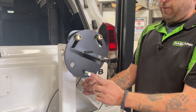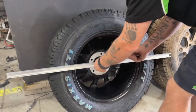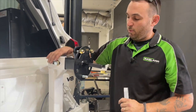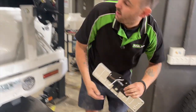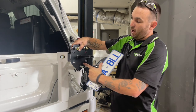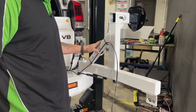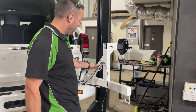The next thing is the wheel plate. This dimension from the mounting face to the upright needs to be 10mm less than the backspace of the wheel. Measure across the back of your wheel and into there — if it's 185, we want this distance to be 10mm less, so 175. Do that up super tight and it needs to touch the upright — that's why we have the crush, it's like a big spring washer. The number plate bracket is a two-piece that goes behind the wheel: nuts off, bracket on, wheel on, and it will poke through the hole of your wheel, then the bracket bolts on once the wheel's on — so that's behind the wheel, not in front. The bracket on here looks like it's backwards but when it's open it will read the correct way. This bracket is for if you buy one of our light poles — knock the light pole in with a rubber mallet and nip it back on.